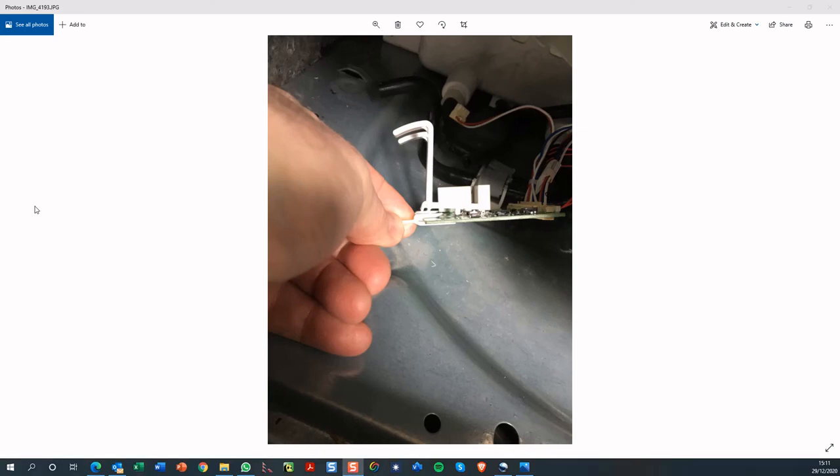This final section shows the circuit board located behind the twin DOS containers. This can sometimes slip out of place and give rise to problems such as failure to recognise that the containers are in place. At the top are two little white levers which get nudged by the twin DOS containers when they're in position. At the other end of each of these two levers is a small push switch connecting to a micro switch, telling the circuit board that the twin DOS containers are in the right place. This whole assembly can fall out of place and give rise to odd behaviour, but you can easily reach it once you have the back off. Pull it out, take a look, see where it fits, and push it back into position along two small ridges. You'll feel it click into place and any error messages should disappear.